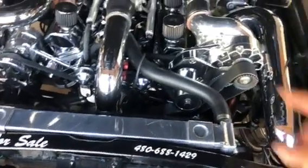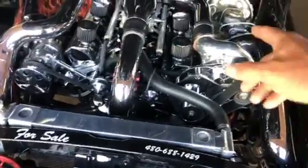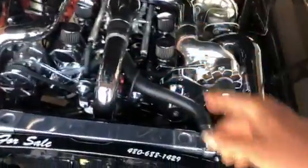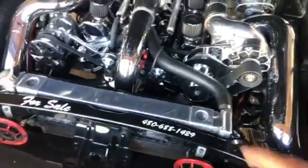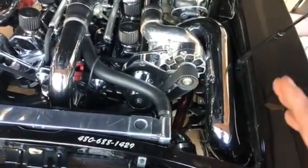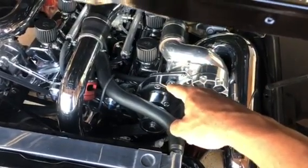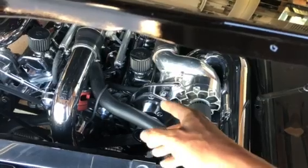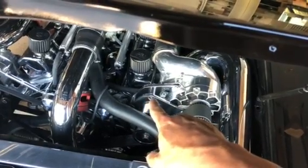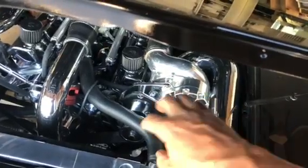We made it look very complicated. We could have had a straight shot into the intercooler, but it just wouldn't look as cool. There's only a bolt there and a bolt there, and then that pops off, so it takes just a minute to remove. I haven't had to take it off since I put it on, other than to change the air filter — just one screw. Then you've got a throttle body. We had to majorly customize this kit. Originally the supercharger bolted into the motor with just machined plates with bolt heads; we took those off, had new ones machined rounded so they were smooth, chrome-plated for easy cleaning, and put stainless steel recessed allen heads in so you're not banging your knuckles every time you clean it.